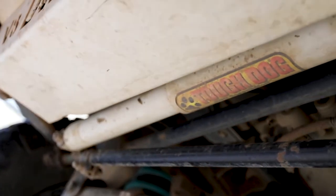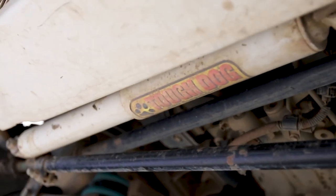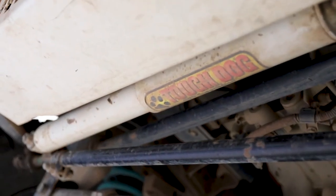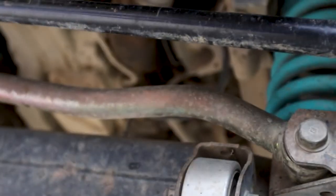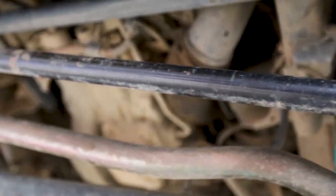When you're chasing down death wobbles, always start at the cheapest end. So I went and got the wheels balanced. Didn't fix the issue, but I know that's not the issue now. Found the issue with those, replaced that. Now I've only got a slight issue back to how it was originally. So I'm gonna change these out and go from there.